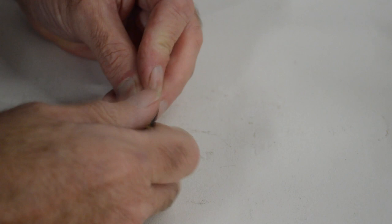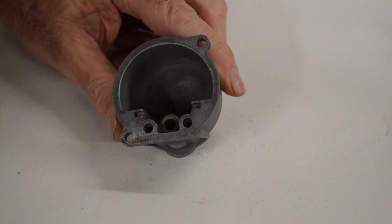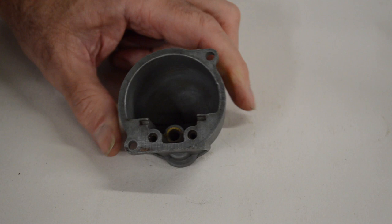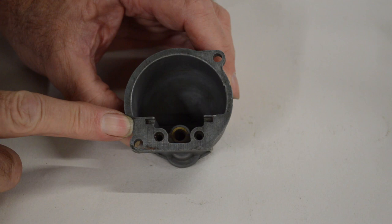So they go together like that. We've got the carb top which is alright. The float bowl has obviously been cleaned; you've got a seat for your needle. These surfaces can warp again in relation to the carb body where it joins - there is a gasket which will be replaced when we rebuild the carb. This will be put on some abrasive paper on a sheet of glass to make sure it's flat. That's a fairly quick process.